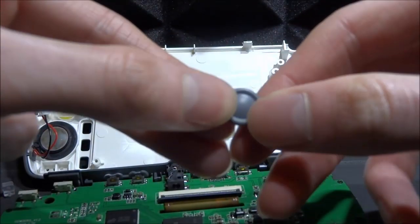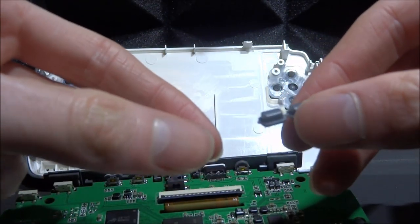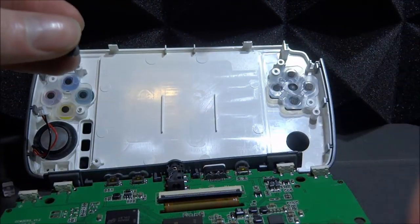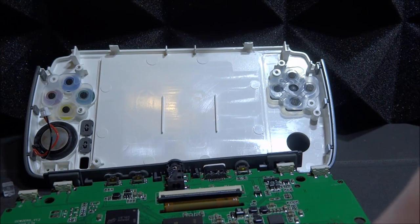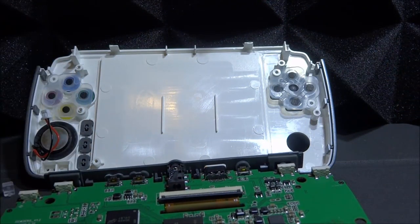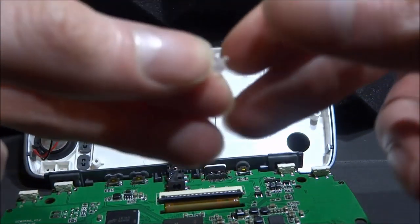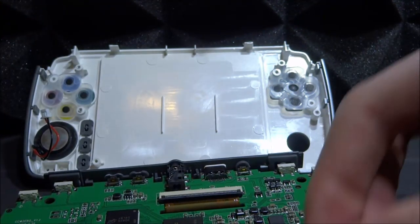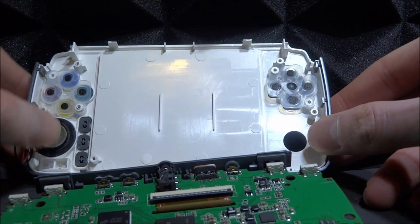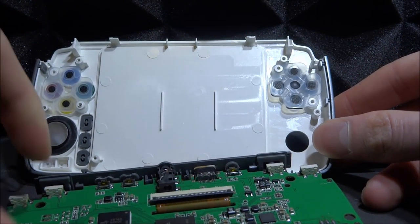We also have the analog stick — if this falls out, don't worry. We'll put it back on once it's put back together as that seems easier. Next we have these three buttons — the select, start, and menu buttons. They just sit in here like that. There is a small notch on them; I find it easier with the notch facing the screen. The last thing that fell out is this small piece of transparent plastic — it has two parts that stick out and goes where the LED light is, under the speaker, through that hole. Push it so those plastic pegs go through the housing.